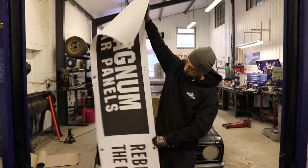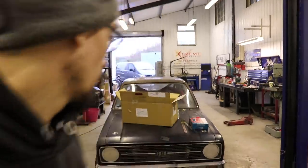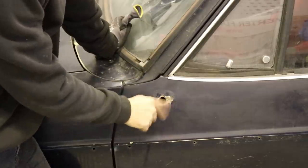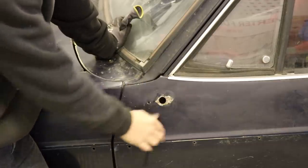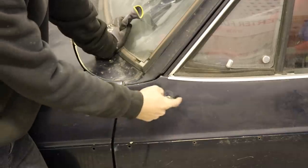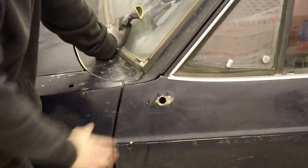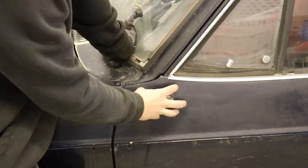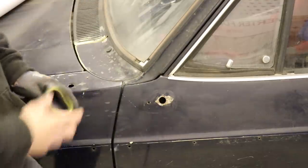I've got a banner to go up, so we'll stick that up on the wall as well. On this side we've got some damage — this obviously had some huge mirror thing put on it and it's probably been whacked and bent all about, and there's a load of filler in here. So we need to clean all this off, weld these holes up, and then re-drill it where it wants to be. Then I'll make a backing plate, cut them out on the plasma table, that will go in behind it to sandwich it all together and stop it from buckling if you ever hit it.